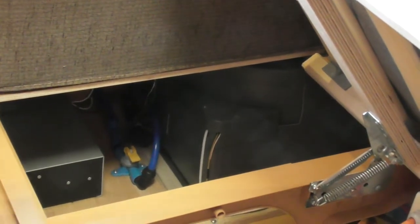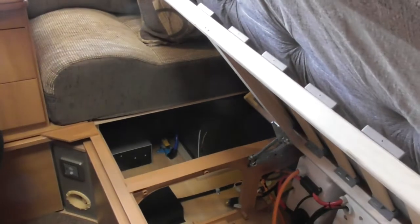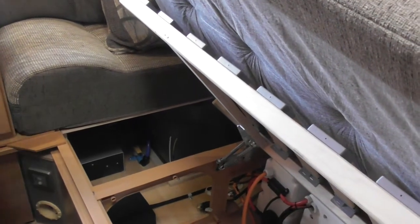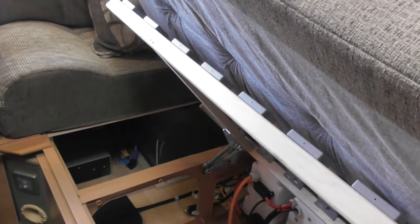When it comes to winter time for draining it down, all you need to do is lift that yellow lever so it sits straight up in the air like that. So that's open? Yeah. And when it's open, it will drain all the contents of that water boiler down. And if you leave your taps open in the central position, so in the middle of hot and cold, it will simply drain all the water out of the pipes and all the water in the van will simply drain out underneath that hole. Okay, and is that recommended to do every time we get on the road?